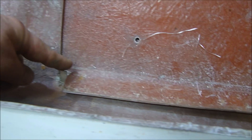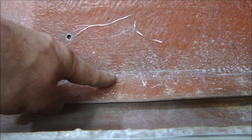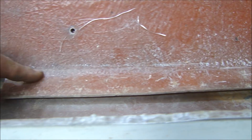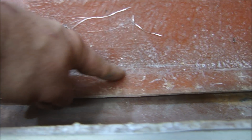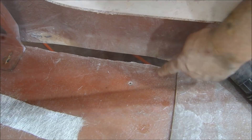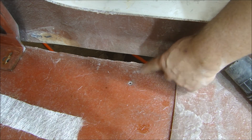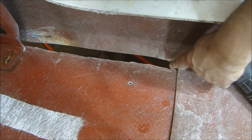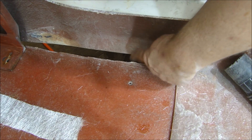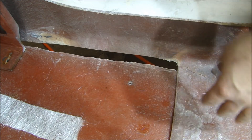First, I'll come underneath and cut this edge of the floor off all the way down along this crease using an air saw — just cut that right off. In order to fix this properly, I can't just put fiberglass right on top of the gel coat on the other side because it just won't stick. I have to rough up the surface on either side to get down to the raw fiberglass so I've got something to really stick to.